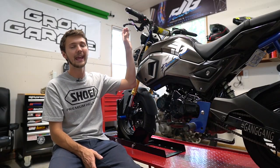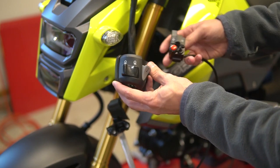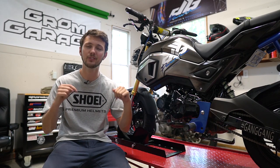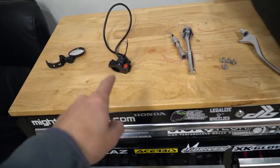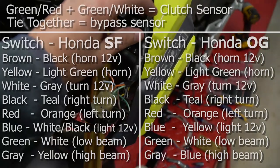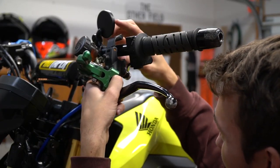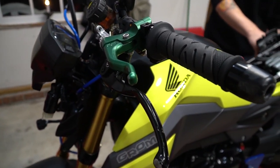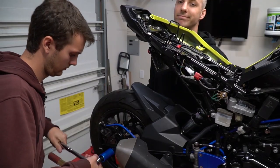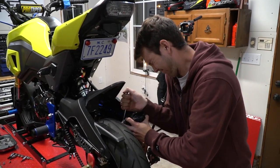One thing I wanted to do was install a handbrake setup, but with the stock control unit it was just too big, so I had to install an eBay control — I have a full video in the description. That gave me a lot more handlebar real estate, so I was able to fit the handbrake, which is a Magura HC1. Highly recommend that — if not that, the Brembo, but the HC1 is a little bit better, not too much of a difference. At the back it goes from that stainless steel line to a P32F caliper. Just a heads up: get the P34 if you're going to get a handbrake. It's not a big difference, but I just wish I would have gotten the better P34 caliper.